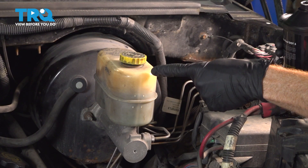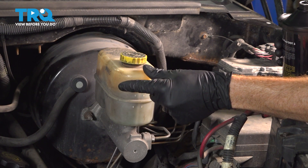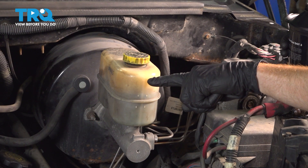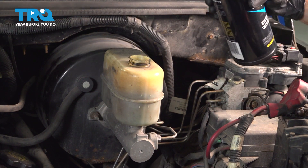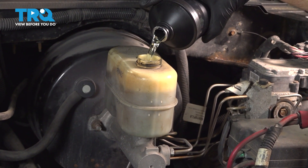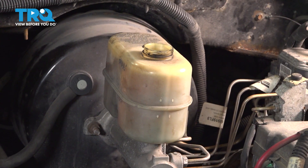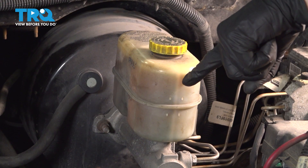Now that we've finished bleeding our brakes, the next thing you want to do is make your way up into the engine compartment. We're going to be looking for the master cylinder — that's what houses your brake fluid. You'll find a full line or a dot along this area. We want to make sure that it's topped off up to that point with DOT 3 brake fluid. Open up our cap, give the seal a quick inspection, and continue on with adding DOT 3 brake fluid up to that fill spot. We have the perfect amount. Continue on with the cap — ensure that it's on securely so no moisture or debris makes its way into the brake fluid.